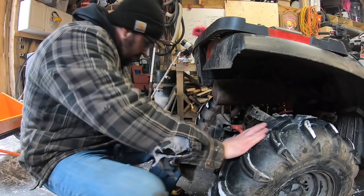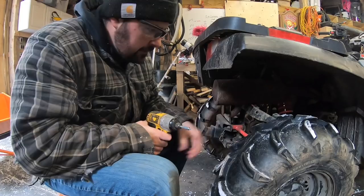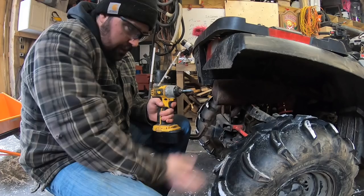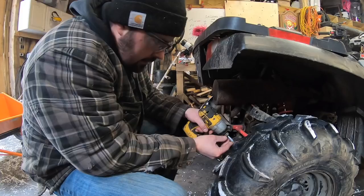All right, the other thing I'm trying to keep in mind here is the lug actually, in the center, it depresses a bit. It goes in a little bit, so I'm gonna try to keep the screw on the highest part of the lug, just so that I maximize the amount of the lug or screw that sticks up. I'm also gonna make sure I don't put the screws in a perfect pattern, perfect alignment, because if one starts to slip, I don't want them all on that particular line to slip, so I'm gonna stagger them as best I can.